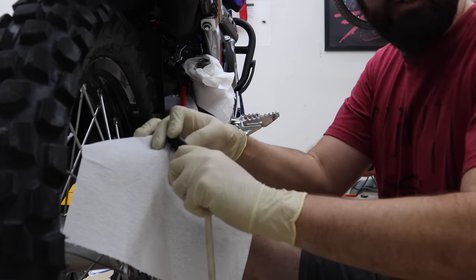The only thing to do now is go take it out for a test ride and see how it actually works. Here we are, out and about in the real world, doing a test of our new brakes. The first thing I did when I got these going is rode around the neighborhood slowly touching the brakes, making sure everything felt good. The front in particular — I've got to remember it's got a whole different rotor, and you've got to give that a minute to bed into itself. You just basically ride around braking very slowly. The ABS light is just solidly on — from my point of view, the brake line almost covers it. I can live with that.